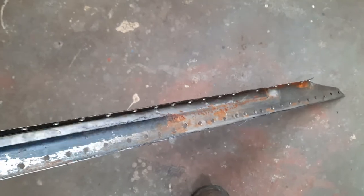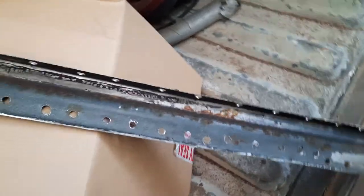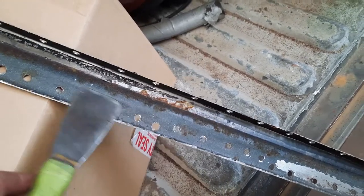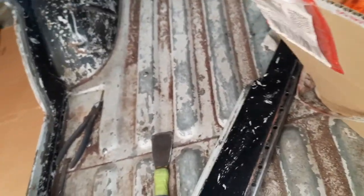This gives you just a little bit of an idea how many spot welds there are. When you drill holes you don't always — some of these will just come straight off if you get it exactly center. If you miss them a little bit you'll have to hammer through there, actually break the handle through hammering just to separate them because they still hold on in places. I haven't primed this one yet — I'm going to prime the inside of that. I'll get all the quarter panel welded, get this piece back in, and then I'll cut some windows in the insides of the pillars so I can finish it.